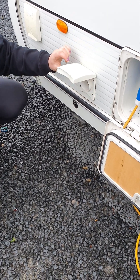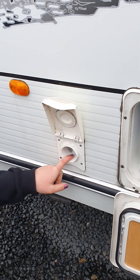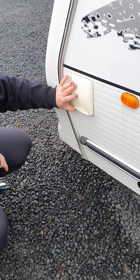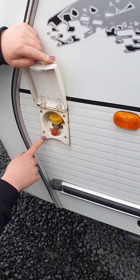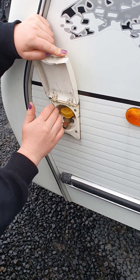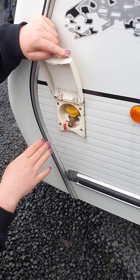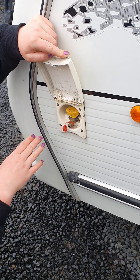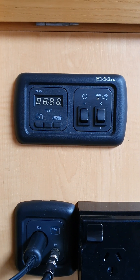Just next to your battery locker is an awning warmer — when you've got your heater on and your 12-volt fan running, this will pump warm air out into your awning. This little compartment at the front is for a gas connection if you want to run a barbecue off the gas bottles in the van. You can get an adapter that plugs in there, but you will need a gas fitter to make your supply line, because the gas bottles in the caravan are already regulated and double-regulating the gas means it won't work.